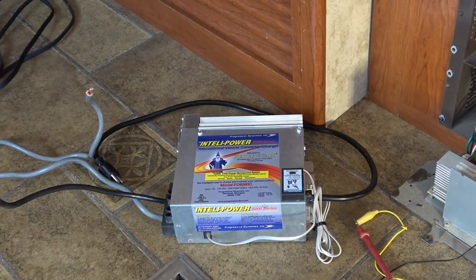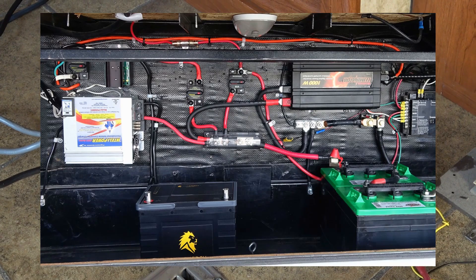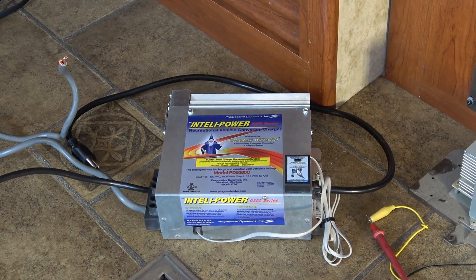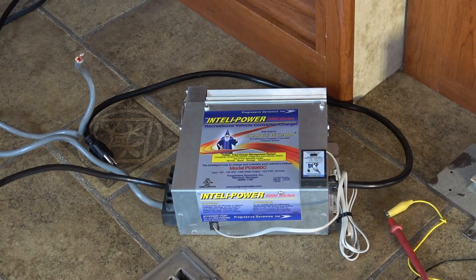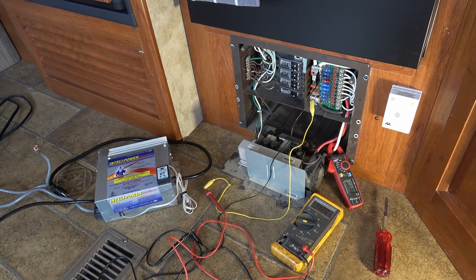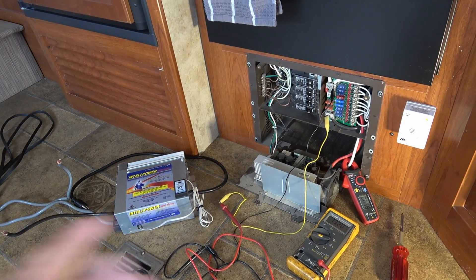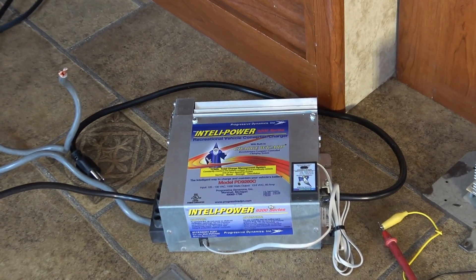Because I was going to be using it off grid, I installed the IntelliPower charger up by my battery bank so it was very close — I wouldn't have that long cable and I wouldn't get voltage drop. This performed really well and I would get a pretty good charge through it. For convenience I put a receptacle at the front of the rig so I could plug my generator straight into it. In the meantime I kept the OEM one, and when we're on full hookups it was adequate because we also have solar power which charges the batteries at the same time.